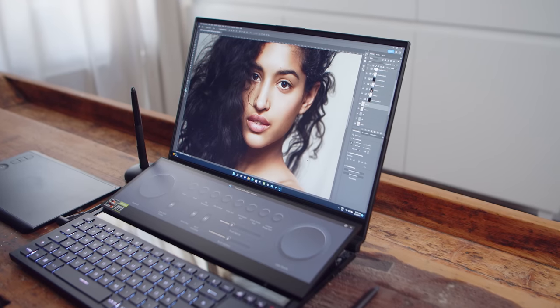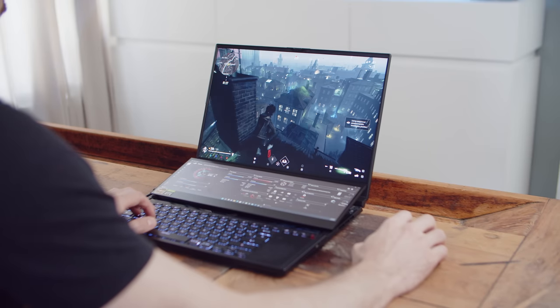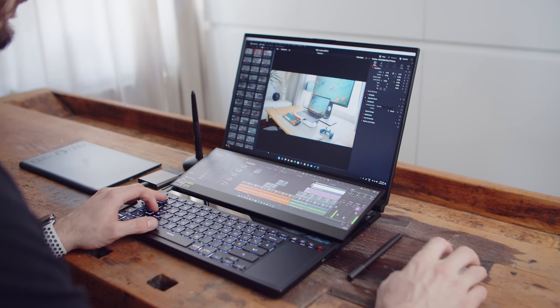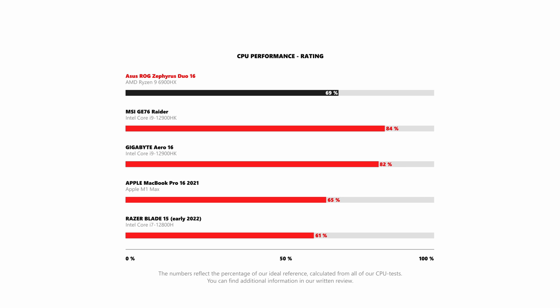When it comes to performance, the Zephyrus is basically a desktop replacement and offers enough horsepower to handle almost anything you can think of. While the Zephyrus line is primarily targeted towards gamers, this thing is a content creator's dream — it doesn't matter if you play games, edit photos, work on videos, or do CGI work. ASUS opted for AMD's latest 6900HX as the brain for the Zephyrus, and it delivers solid numbers in the CPU department. It can't quite keep up with high-powered Intel laptops like the Gigabyte Aero 16 with its i9, but it can easily beat laptops with conservative power levels like the i7-12800H equipped Razer Blade we recently tested. The two NVMe drives in RAID 0 offer around 10GB per second read and write and ensure a very snappy user experience in general.